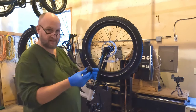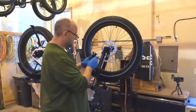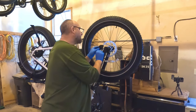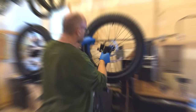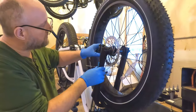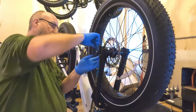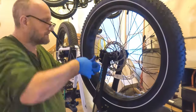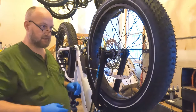Now to put the new caliper on — these are the Tektro Aries calipers. The adjustment goes on the inside and the lever arm goes on the outside. The big side of the bracket goes on the top stud, which in this case is the bottom because I have it flipped upside down. Slide it on the rotor and start the bolts. Once it's snugged down, back it off so that it's slightly loose, then work on the other side. Snug both bolts down, backed out just a little bit so it's loose — I'll need to do that so I can adjust it to the rotor.